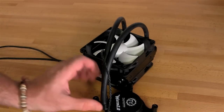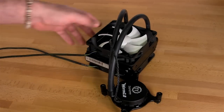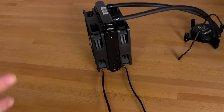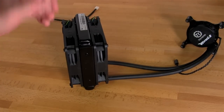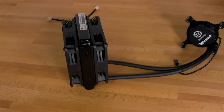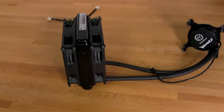That wraps up how to set up the head unit. Installing this inside a case is pretty easy, which we cover in the review — click the link below. You just put your front fan on, then line up the holes in the back fan with the back fan mount holes on the back of your case. We've seen a couple of cases where this doesn't fit, but where it does, you thread the screws through the holes and make sure they line up with the radiator, then screw everything into place. Thermaltake also provides small plastic grommets to help reduce vibration noise from the fans. From there, go ahead and plug your fans in and plug your cooling head in.